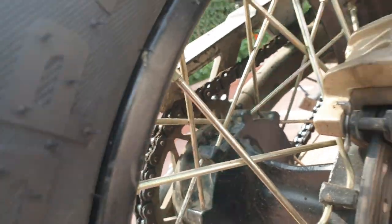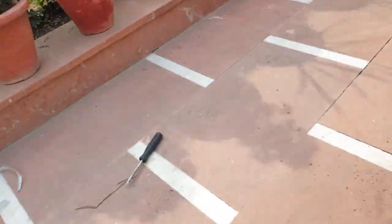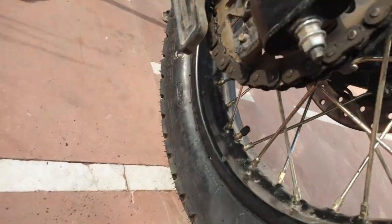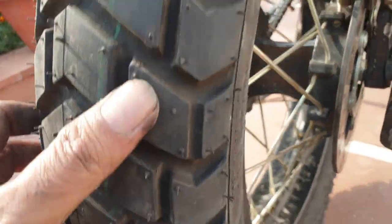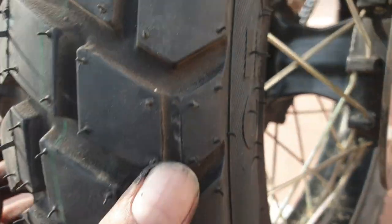All that's left to do now is put this back in. Make sure the brake is aligned, make sure these screws are tight — no gap here as well. Chain indeed needs cleaning, that will be done later. Everything seems okay. Final thing: tyre rotation should be this way. All done.